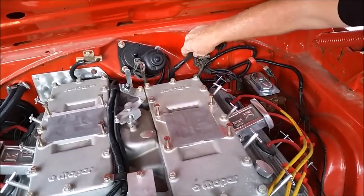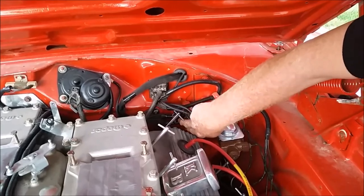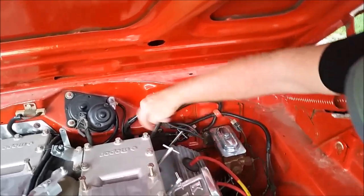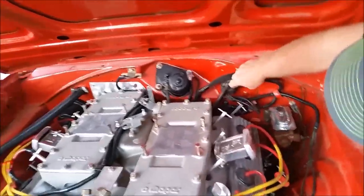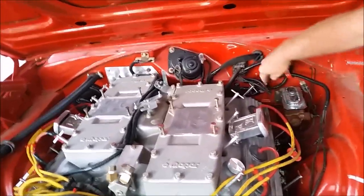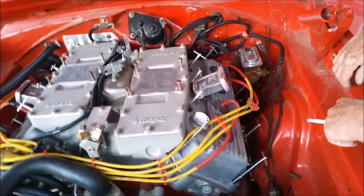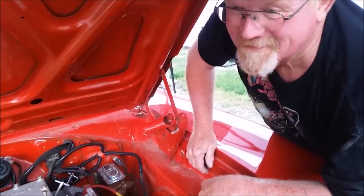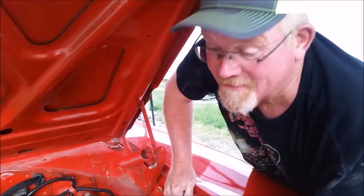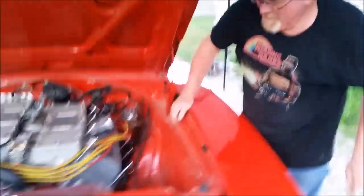This main battery cable's coming right to the starter relay, on the same post, picking up the same post going down to the starter. Yeah. This fusible link's still intact to the stock wiring harness. In case anything goes awry in the harness, it'll fuse this wire here. So would you say it's a nice blend of your wire and factory wire? Yeah, it's kind of a blend of Scottization, what I like to call it. There ain't no fancy Year One bullshit here or anything.